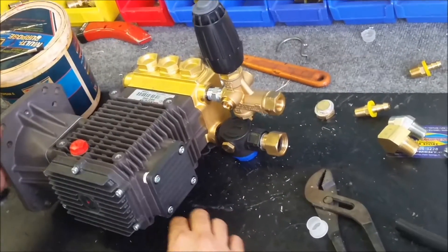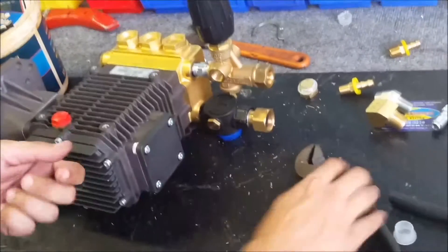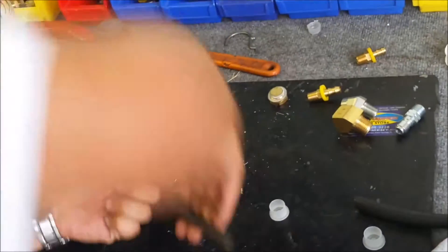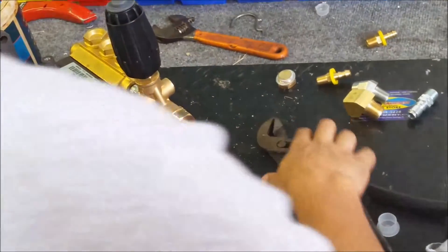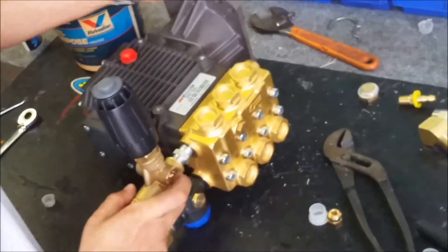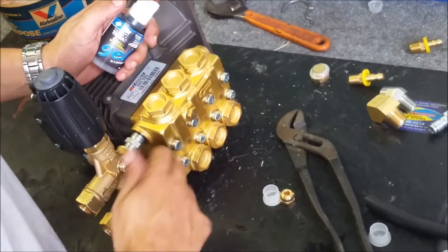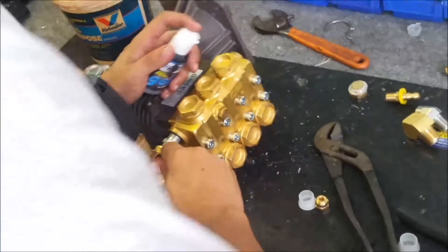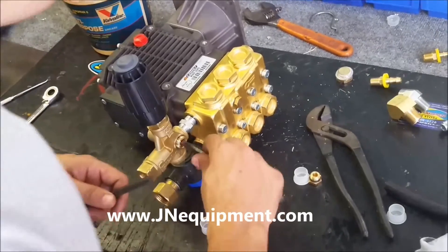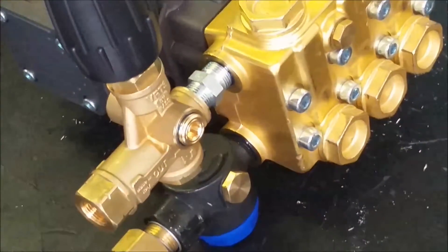What I'm going to do now is remove this to get it out with an Allen key if you need one. I'm also going to remove this side. The bypass could really go on either side — I always prefer this side, personal preference. Truth be told, it doesn't matter. So I've exposed both sides, but I want to plug this side back off. A little VibraTite, get that in there so it seats at the bottom. It's not very deep — pretty much as deep as it's going to go. I barely gave it a three-quarter turn just after hand tightening.